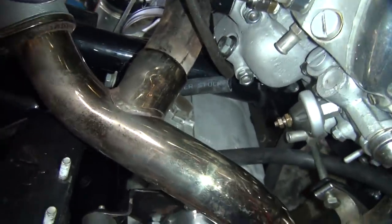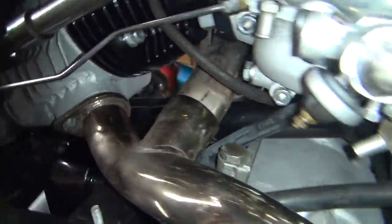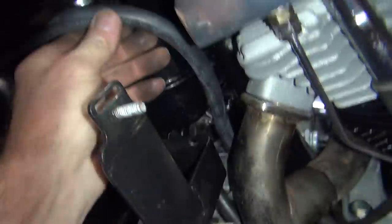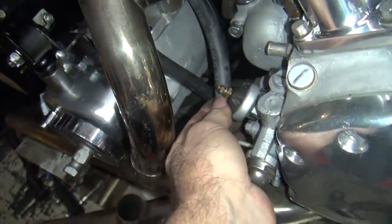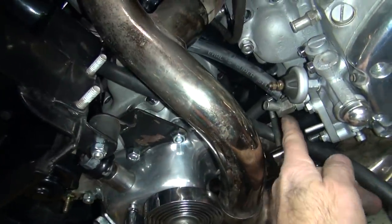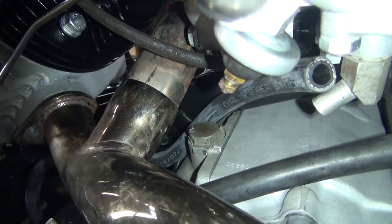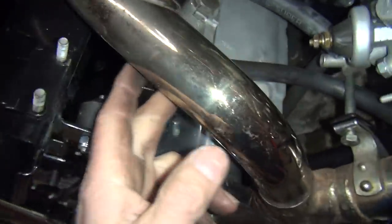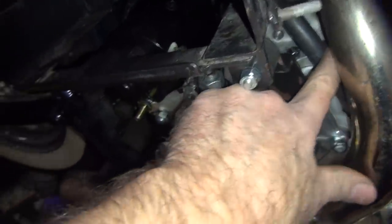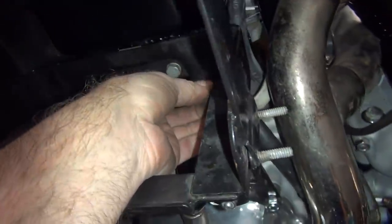There — perfect. That'll work. That goes up top of the tank up in here — right there. You can use that for the return line over to here, go right to this spot. That'd be a hell of a bend though — I'll have to rotate that back a little bit to make it line up better. That'll be a good fitment there, you've got good clearance for the exhaust. When the vent line comes out of here we'll just run right up this other side. The feed line — I want to keep it back over here somehow, but it's rubbing up against the tank, which is going to put a hole in it. So that's not good.